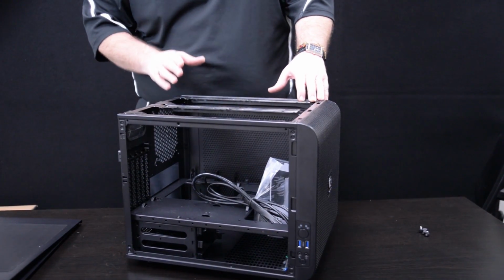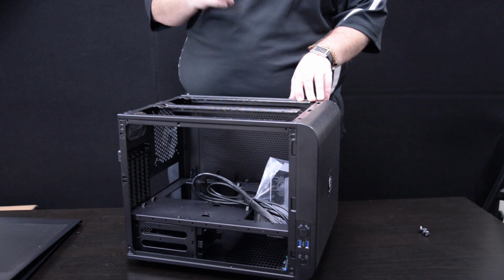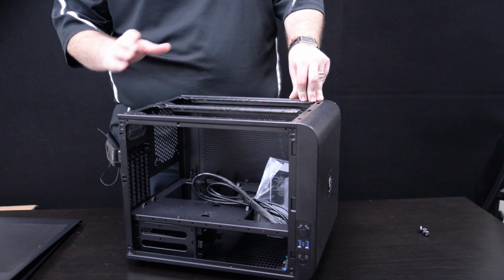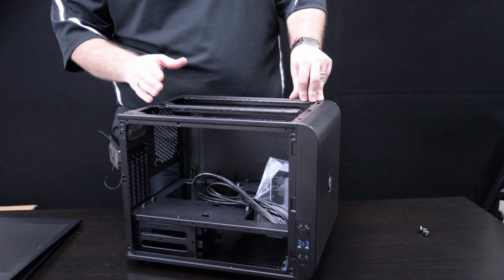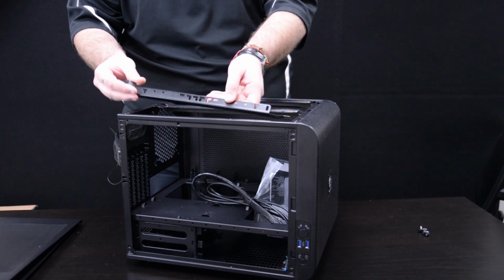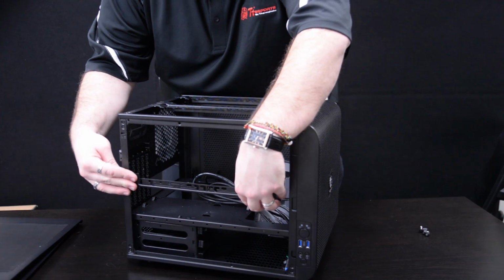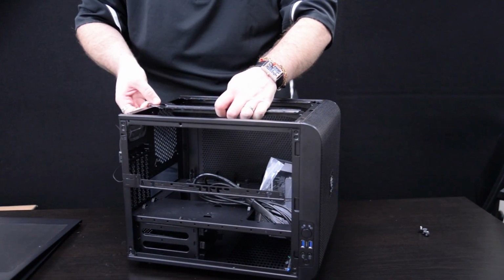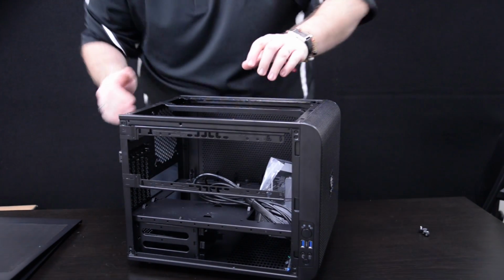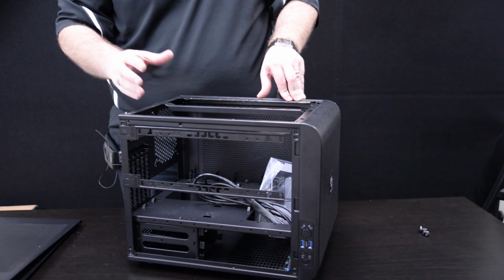Okay, now for the V21, like we said before, we wanted to make sure this was a truly versatile option, whether you're talking vertical or horizontal motherboard mounting, and this includes your cooling, your fan mounting, your radiator mounting. So what we did here was we actually gave you modular rails for the radiator or fan mounting so that you can pull them out, mount them wherever you need, snap them into place, and this can actually be adjusted because there are multiple cutouts that will give you the distance, whether you're doing 120, 140, or even 200mm based.